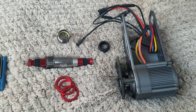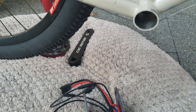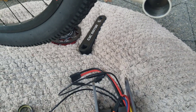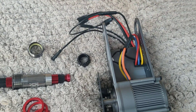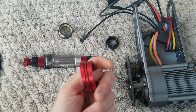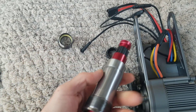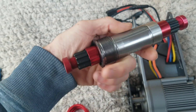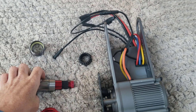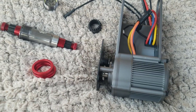We're on to the main part of the show, which is to get the motor fitted into the bottom bracket of the bicycle. In my case this one is a 68mm bottom bracket, but you can also fit this type of motor up to an 80mm bottom bracket. To do that we use these spacers — a 3mm, a 5mm, and a 7mm — which will space out the different sizes depending on what bike you have. This is the bottom bracket piece itself and that runs straight through there. I'm going to put it together outside of the bike so you can see the sequence of how it looks and then we'll get it fitted on.